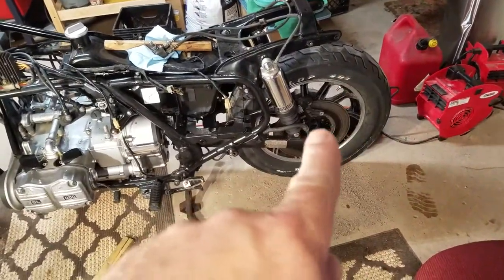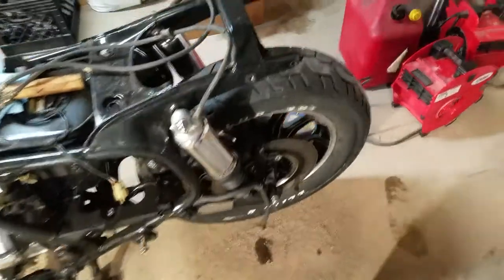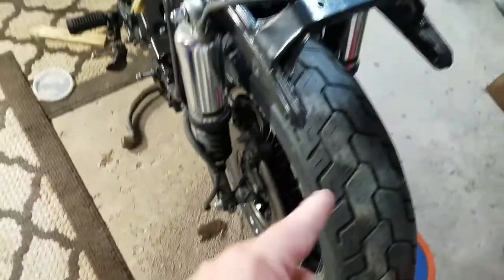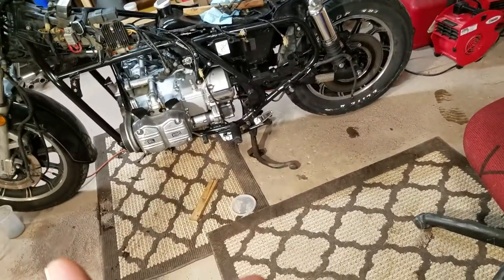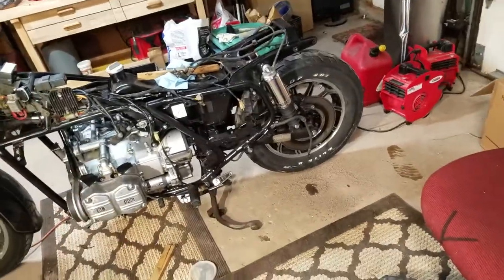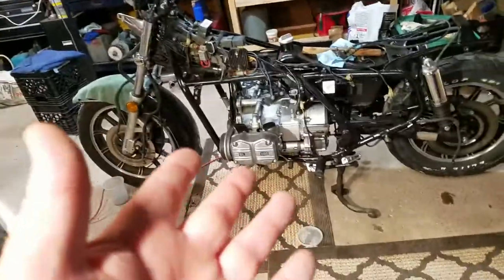You can tell I cleaned up the frame, and I'm cleaning up the tire — I need to go over it again. There's about 30 years of grime on there. At first I thought the paint was just pitted and crappy, but it's actually coming clean pretty well. This is just 30 years of gunk. I picked up a stiffer brush with nylon bristles. I've tried everything — Simple Green, Super Clean, some Meguiar's mag cleaner — and it's taking all three of those together.